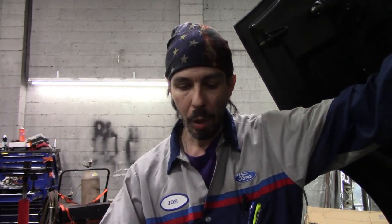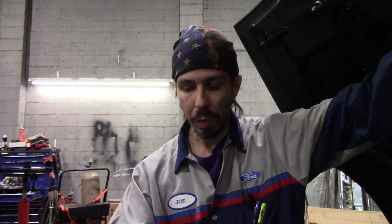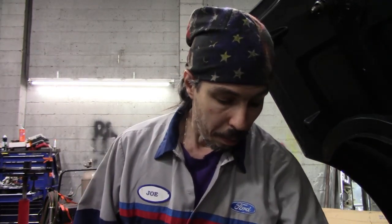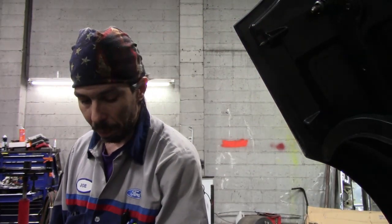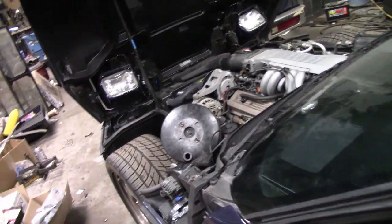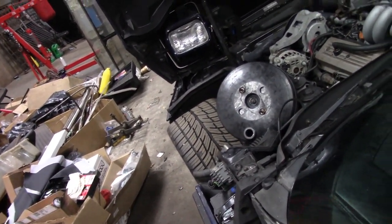It's kind of sucky because if this car had come to a professional who knew how to test, they would have found the vacuum leak as soon as they saw the fuel trims. If they had any experience they would have checked the booster when they didn't see an obvious leak, replaced it and fixed the car - it would still have the original Bosch sensor in place, which would have been better. None of this other stuff would have been tampered with and damaged. But as it turns out, the guy apparently tried to fix the car himself, gave up after spending money on junk parts, and sold it.